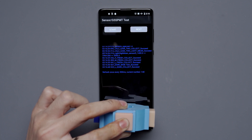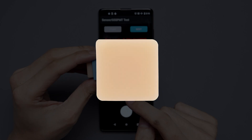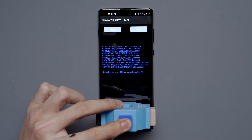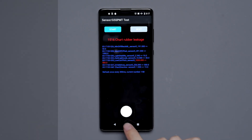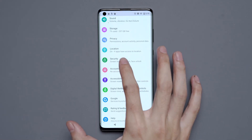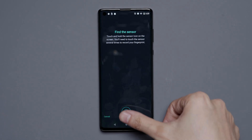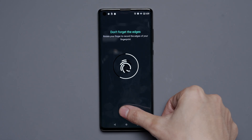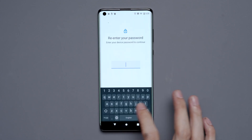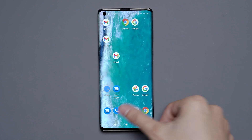Then it will prompt Test and Flash Chart 3. We're going to select the yellow module — specifically the light yellow module — and hit Next. You may see an error 1516 on the chart, but this error depends on the system and you can pretty much ignore it. We'll go back to the home screen, open Settings, and add a fingerprint again through Security, then Fingerprint. Put in our passcode and hit Setup. Now you should be able to register your fingerprint. Follow the on-screen steps until you've completed the scan. Once done, let's test it — go back to Fingerprint, and you'll see the fingerprint has been successfully saved. Now let's try to unlock the phone, and you can see that it works again.